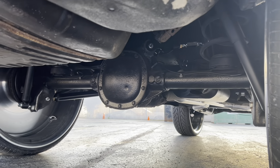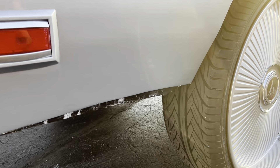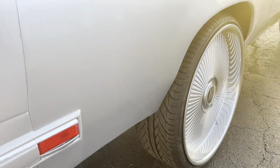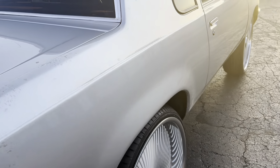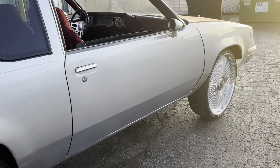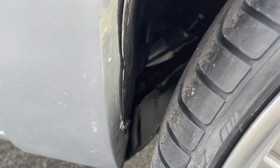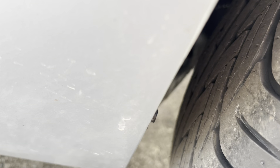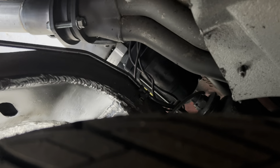When you put weight in the trunk with stock springs, it comes down more than with a coilover spring — you can push it down with stock springs much easier. The front quick frame notch: I plated it with the whole center piece in, it's not going to be a problem at all. Cut the front of the fenders for clearance — it touches just a little bit at full turn. The back side is up, and that's with the wheels sitting in more.